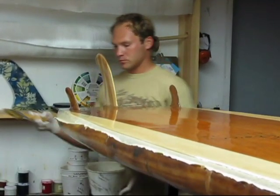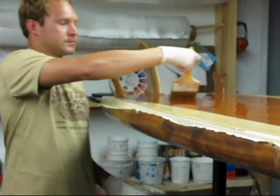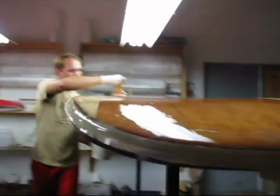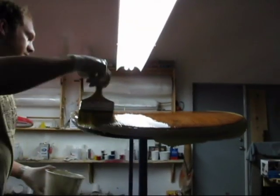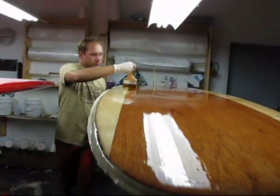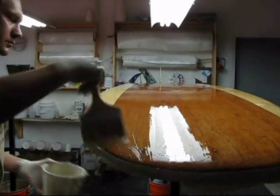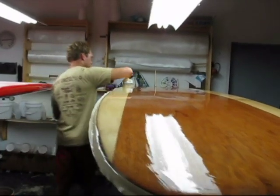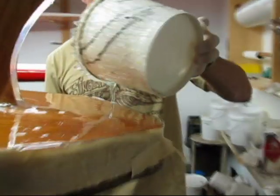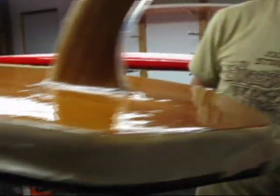And that wax additive that you put in there, called surfacing agent, rises up and seals it off airtight so that the resin cures so that you can sand it. Without that, you're going to be gumming up a lot of paper. Yeah, we're at the tail using a little bit of the excess, getting that little brush bristle out of there. That's what you get for using a cheap brush.